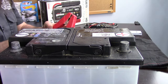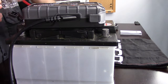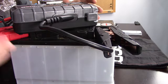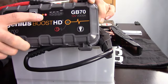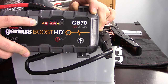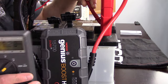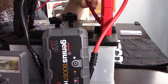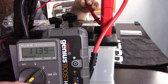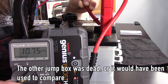So this is an old battery out of my Cabrio. Just for fun, I kind of want to hook it up and see what happens when we actually hook this up in reverse. I'm going to turn it off, hook the positive to the negative, and the negative to the positive. And you'll notice right away that the light comes on saying that I got something wrong. I can turn it on — no sparks. Obviously it's not hooked up to a car, so no fried ECM. But it immediately gives you a warning that something's not right. We are just over 6 volts. I'm going to go ahead and turn this on — watch the voltage jump right up. This is still a little bit light to start a battery, so it would probably have to sit on the battery for three or four minutes before the voltage is high enough to start the car.